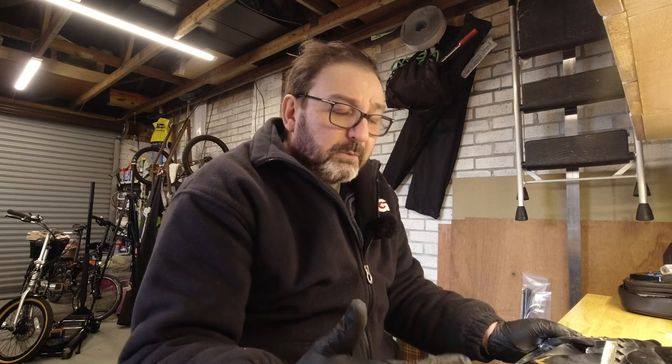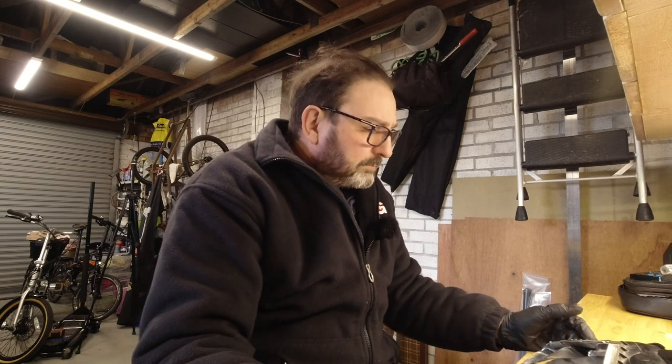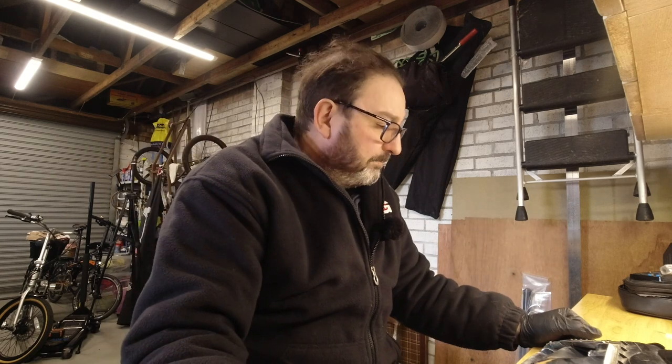The glass and the plastic, totally different heat properties. It will lose its heat really fast. This stuff resets, and yeah, they're really well attached. So I think working it with a hairdryer or heat gun is a safer, more gentle way of doing it. Prepared to be wrong. So now I have one headlight.